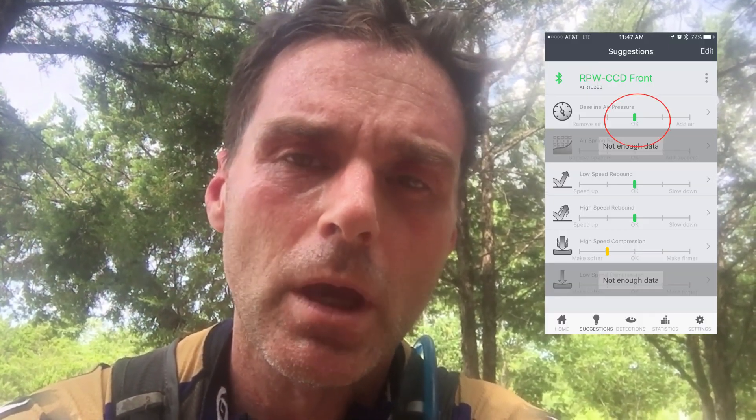I just finished two laps. Unfortunately I forgot to take photographs of the front fork settings, but I got an 82 and I took about 12 PSI out of the front fork, then went out on the same loop covering the same terrain. The loop was two and a half minutes faster — part of that was clearing sections I hadn't cleared before and getting my bike legs — but the bike definitely felt more in control. It only showed a confidence interval of 49% with a lot of incomplete data, but the air pressure was in the green for compression.